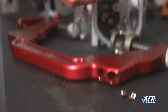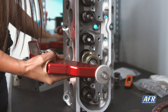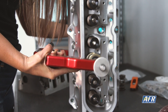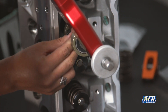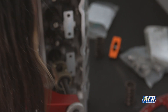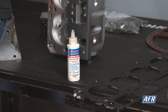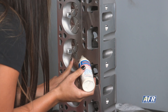Put your retainer on your test spring and insert it over the valve stem. Try to keep everything centered — once you get some pressure applied, you can really work on getting it centered. It's not a bad idea at this point to put a little oil on the face of the valve so the clay doesn't try to stick to the valves when they open.